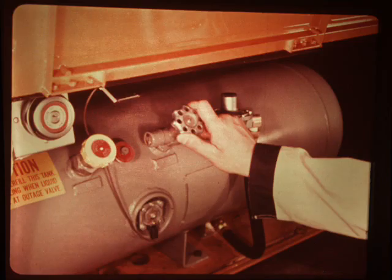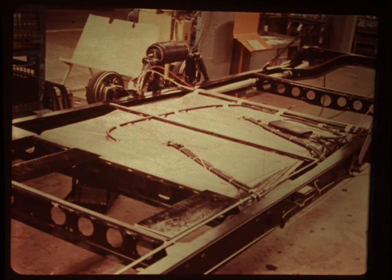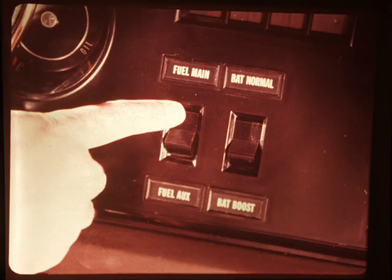There is an important safety precaution to remember: all pilots should be turned off before filling the gasoline tanks. Unleaded or low-lead fuel of approximately 91 research octane number or higher should be used. Each tank has approximately a 25-gallon capacity, and there is a connecting pipe between the tanks. There is a fuel switching device on the instrument panel. When the tanks are filled, the switch should be put on main and left there. With the switch on main, fuel will be drawn from both tanks because of the connecting pipe, allowing use of 41 to 42 gallons of the total 50-gallon fuel supply.